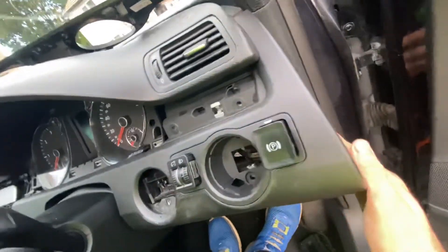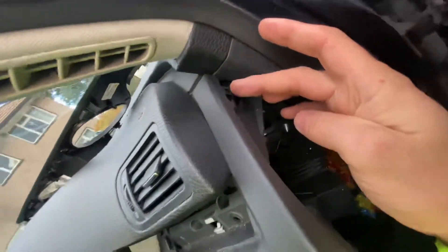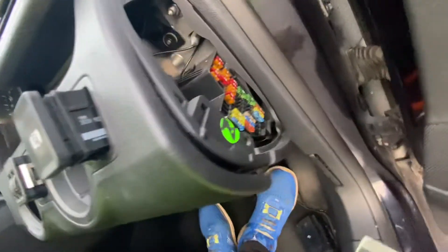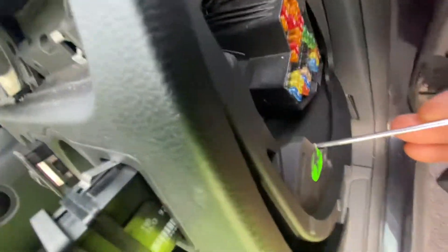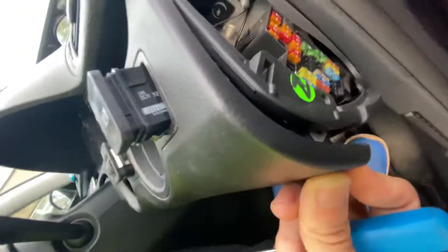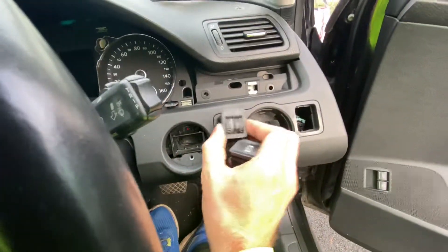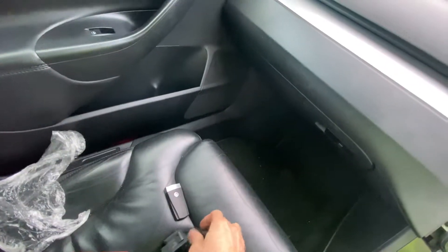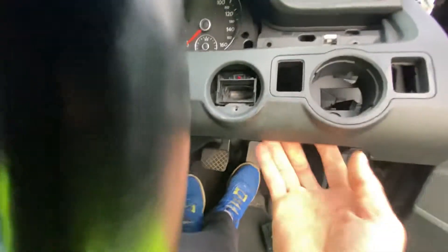You have a cover in here that you have to take off. And then remember there are two screws here - one there and one there. You push this one in, you use a pry tool or a pick tool to push it in like that so you can just get it out. I'm gonna get all of these switches out because I already disconnected them - you can see the plug. When you do it, you can take it out. Then this bit comes out.